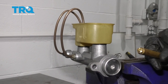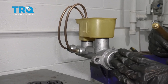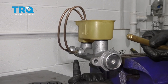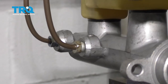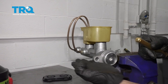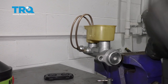Before we can get ready to install our brand new master cylinder, the next thing we have to do is bench bleed it. We wanna make sure that we have this full of fluid before we go ahead and put it in the truck while it still has air in the system. To do that, I used a couple of fittings that fit perfectly into this, and then I just ran some brand new brake line that leads up and into the reservoir. You wanna make sure it's gonna sit down inside the fluid so that when we start pushing fluid and air out, it's gonna go in here and the air is gonna make its way out along the top, but it'll continue filling with fluid.